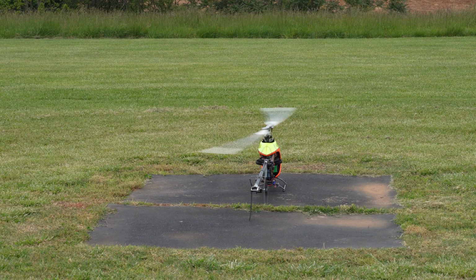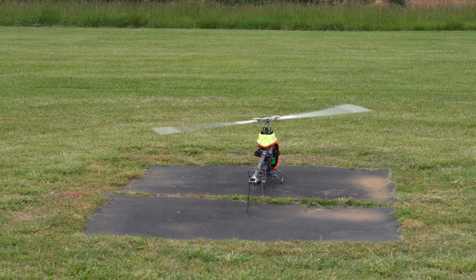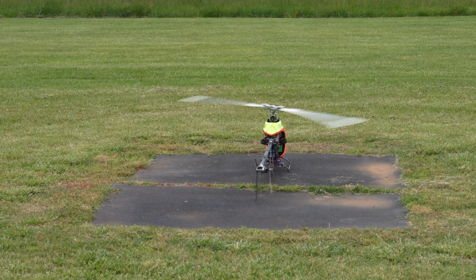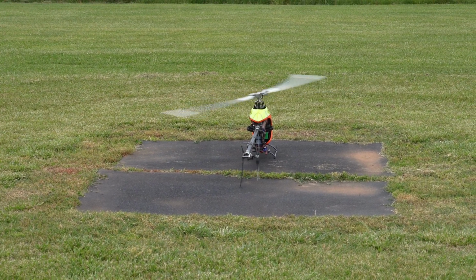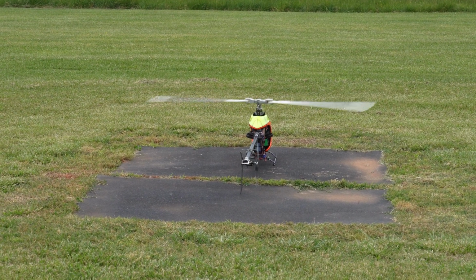As soon as I get up there, I'll just shut it down to this speed. And then you put it back on when you got low? No, the motor doesn't provide any power. As soon as I shut it down to this speed, the motor is not providing any power to the main rotor. So that flare was all without power? Just gliding, yeah. That was cool. Can you do it again? I'll show you again, yeah.